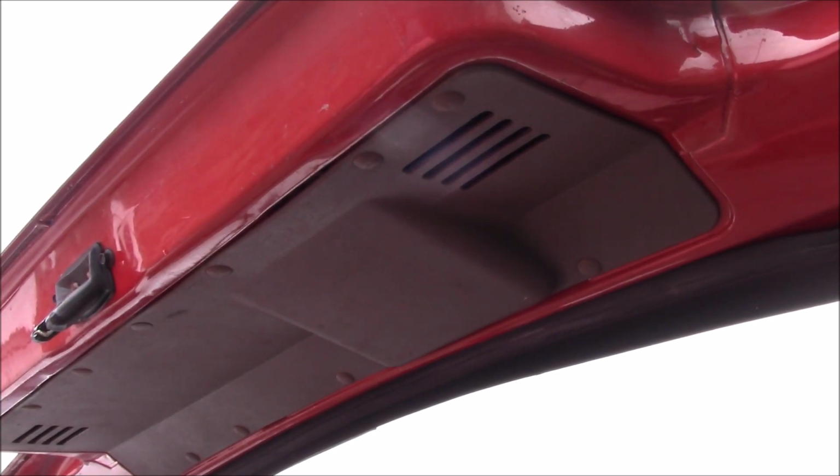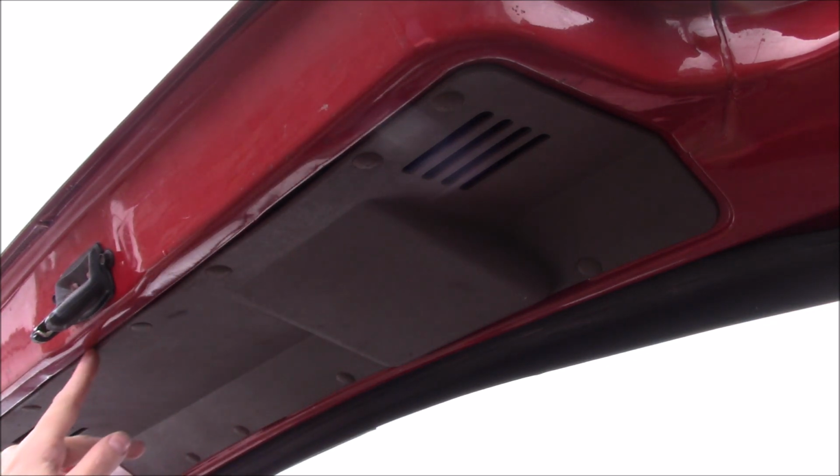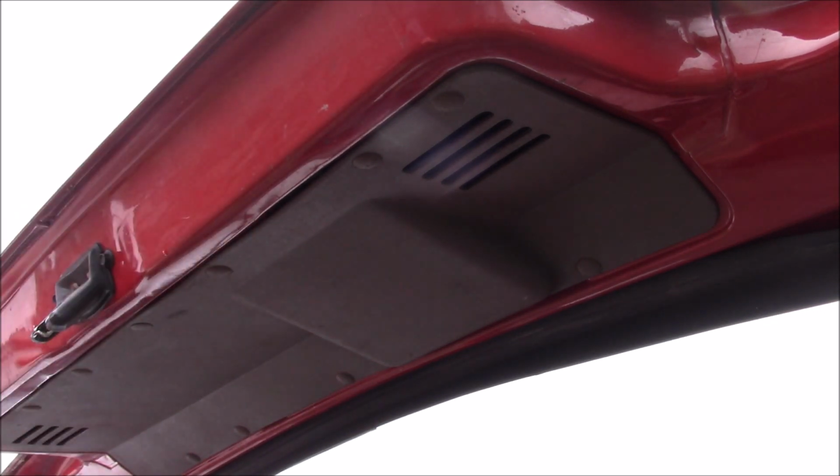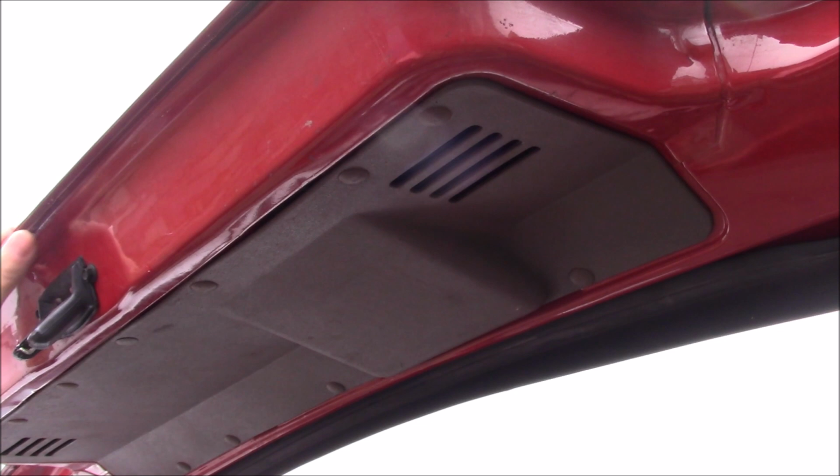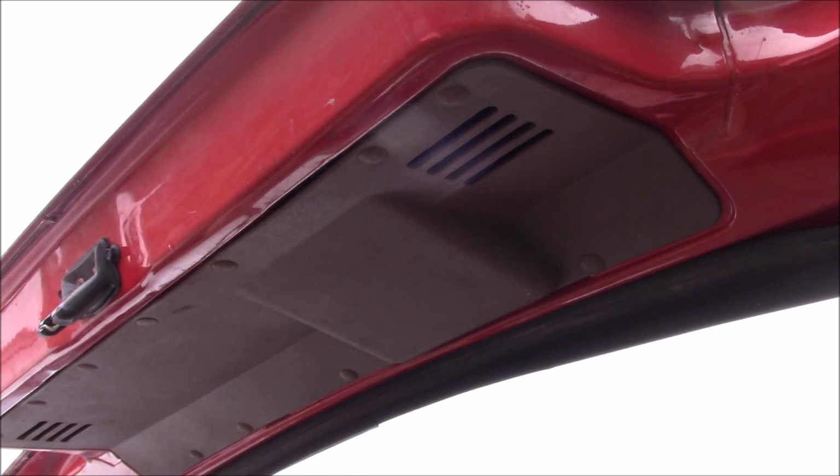After a bit of thinking on the tailgate seal, I realised there's another way the water can be getting in, which is this trim panel on the inside of the tailgate. I noticed with the water, a lot of the time, you were seeing some along this edge and some along this piece. Now, it could still be coming in like I thought it was, but it might be coming in through the wiper spindle on the other side of this. And if it is, popping this off should tell me.